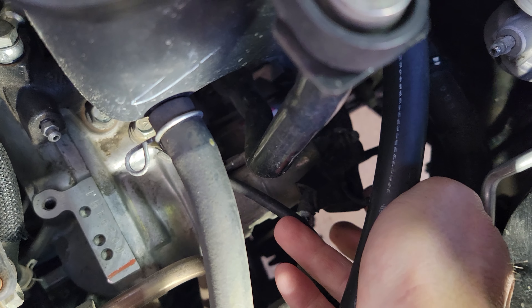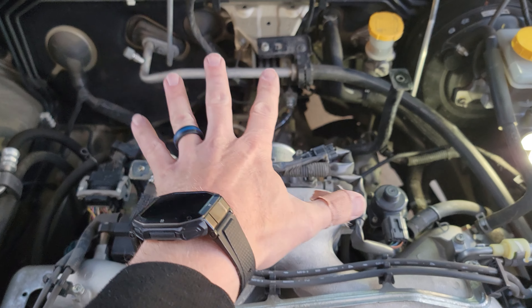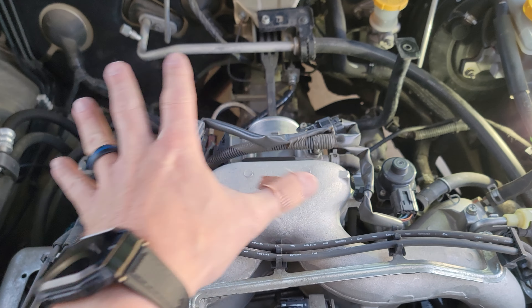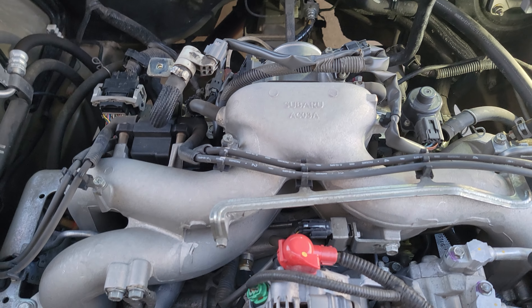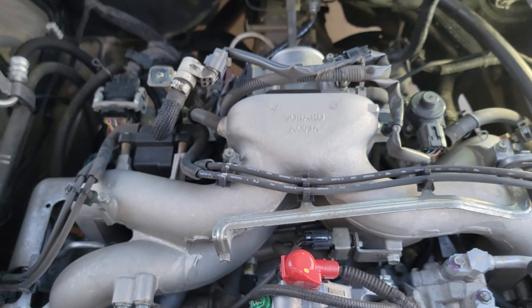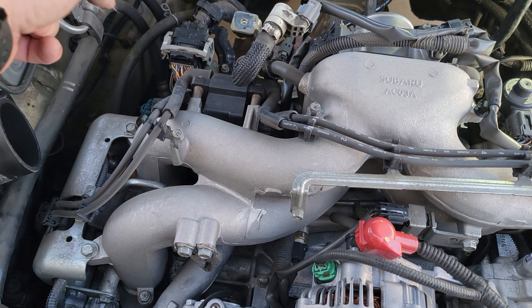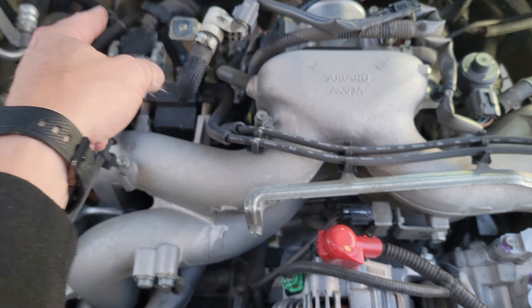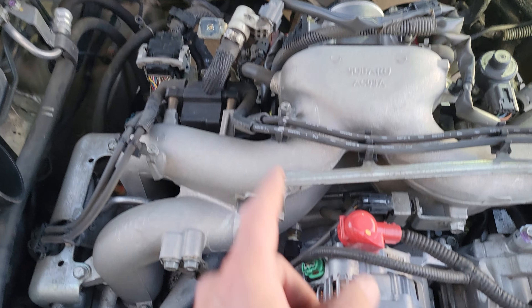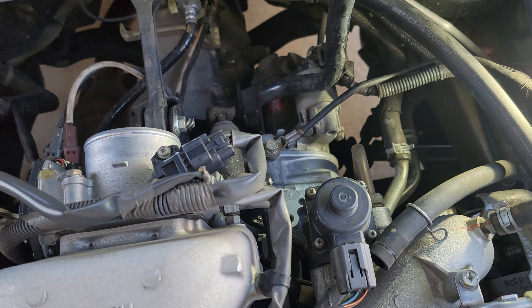We need to disconnect this, so you're going to want to pull this little rubber tab back here. Down below that there is a little two-prong connector — it's just a pull-off. For filming purposes I did remove part of the intake system here. If you decide to do that, it's two 10mm bolts that hold that plastic piece and cover, and then there are a couple connections with little squeeze hose clamps and a small connector — we take that off so we can access it better.